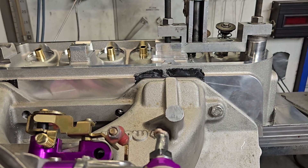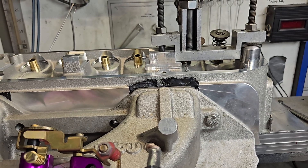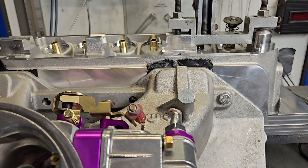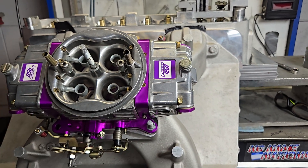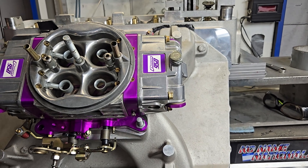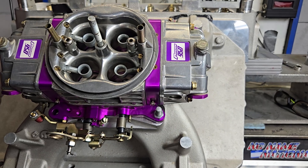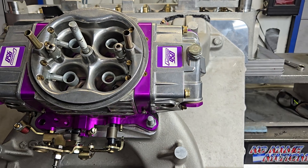I did what I could and it's going to be what it's going to be. Will it pull 6500? I think it'll have no problem. Will it start to ease over around probably 6400, 6300, something like that? Yes, due to the airspeeds I think it will. If it's a real street ride it'll be basically no traction between 3000 and 6000 RPM.